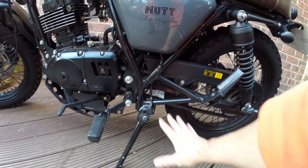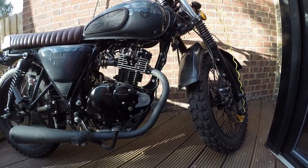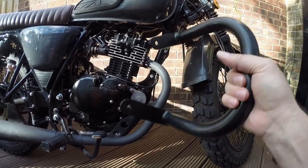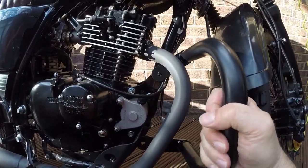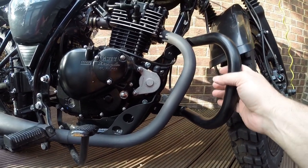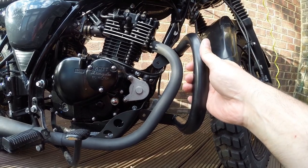I bought some engine bars for the MASH 79, or 72, or whatever version they're calling theirs. Unfortunately the instructions weren't available online. They weren't that expensive, but now that I have them here, I see that they bolt in on that bolt there — but my bash plate is in the way for that mounting bolt. So either I have to figure out how to modify the bash plate so it can slide in between there, or I have to choose between an engine guard or a bash plate.